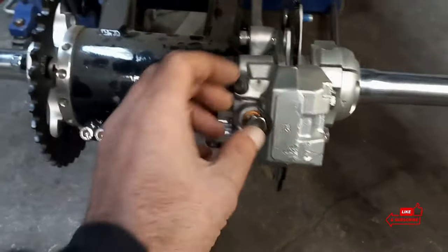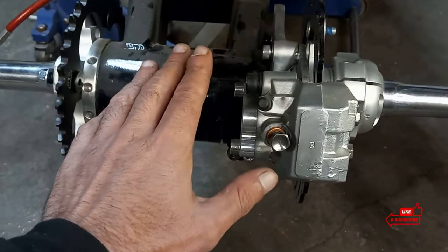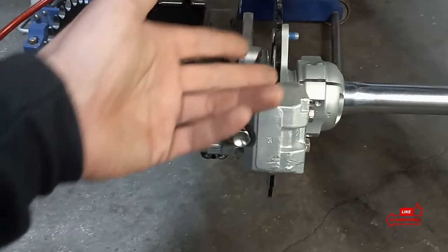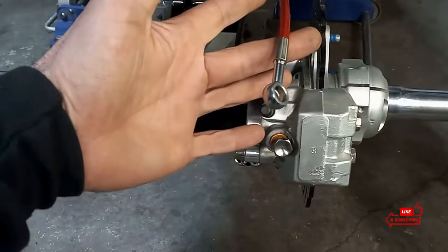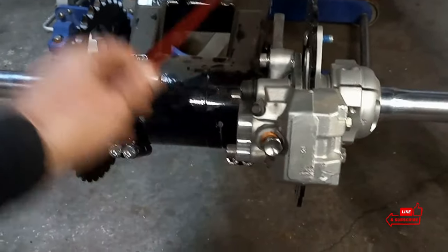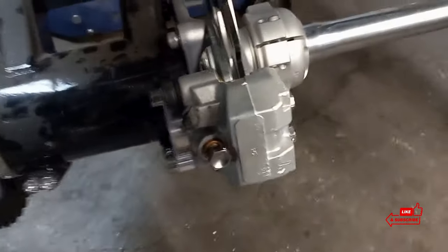You could leave your brake line still attached with your brake fluid — you don't have to re-bleed your brakes or anything like that. But if you have a brake caliper where somebody wore the pads all the way down to the metal plate, you're probably going to want to do a brake fluid flush anyway. We'll get into bleeding and flushing brakes in another video coming up soon, so be on the lookout for that.